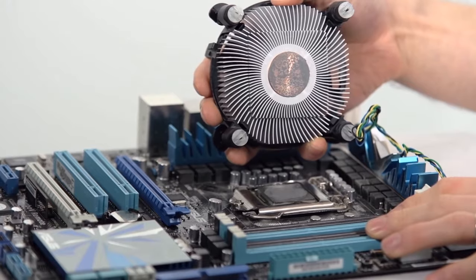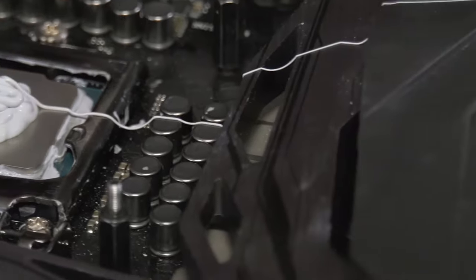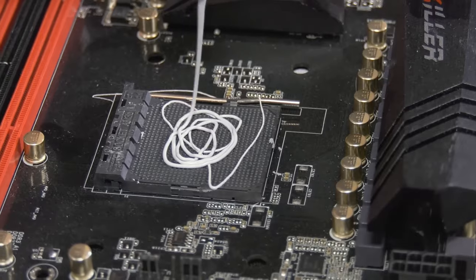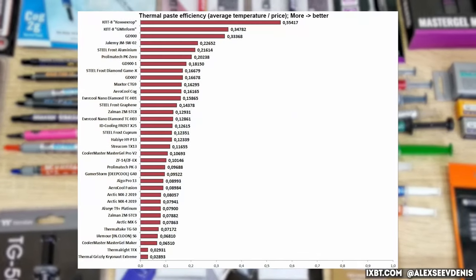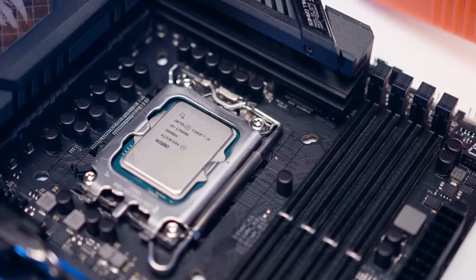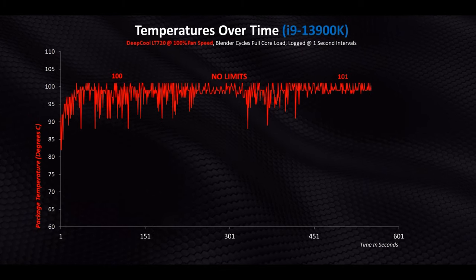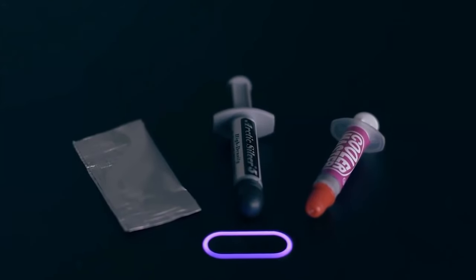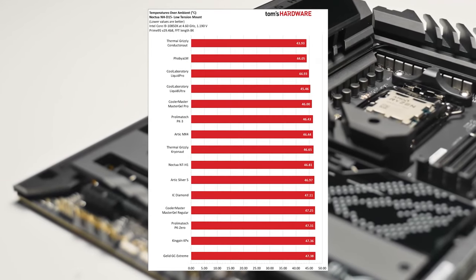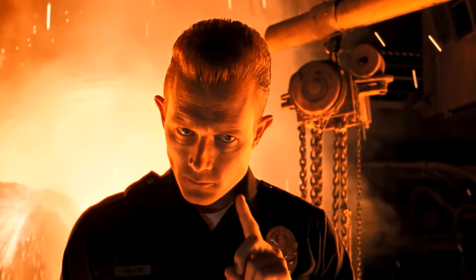Oh, and by the way, forget about preventive replacement of thermal paste once a year. A quality thermal interface retains its properties much longer than that, and if your CPU doesn't overheat, replacing the thermal paste is just pointless. On the other hand, getting expensive thermal paste with a high coefficient of thermal conductivity makes sense only for top-end hot processors, where every degree counts. If you're using a relatively cool Ryzen 5 or Core i5, you can use thermal paste which comes with the cooling system. Usually, it will be behind the expensive solutions by a few degrees at most, which will not play any role.